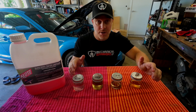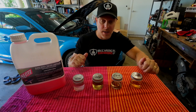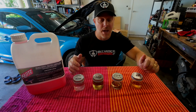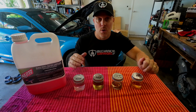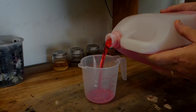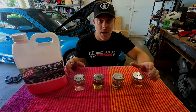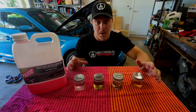One point I'd like to make: if you are pre-mixing your oil in your fuel and you're not running an oil metering pump — which I would highly recommend — if you are running an oil metering pump, remove it and mix your oil through the fuel. It's a much more reliable solution for rotaries. Always mix your oil with the fuel before you put it in your tank. I like to mix it in a 20 litre drum, make my mix, then put it into the tank so I know it's 100% mixed. Even if you do have oil sitting at the bottom of the tank, as soon as you start driving it is going to mix up and stay suspended.